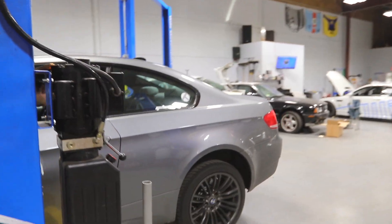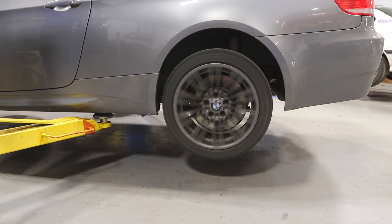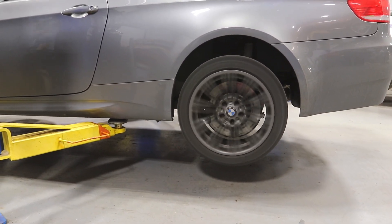We're already starting to see that it's leaking a little bit on its own just through gravity, but we're going to let it run for a second just to get it to move some fluid, hopefully put a little bit of load on it, and then we'll really get to the bottom of where this leak is coming from. Obviously you don't want to push it too hard because we don't have fans going — it's kind of like doing dyno pulls without any airflow.